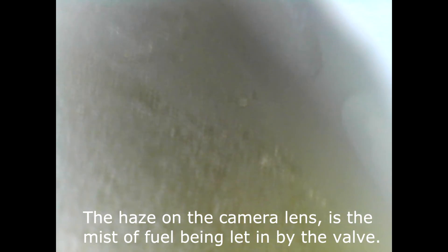It's worth pointing out this speed is actually just the speed the engine is turned over to get it to start — when the engine is running this process would happen at a much quicker speed. This is a petrol engine, but a diesel engine works in very much the same way, only rather than using a spark plug to ignite the air-fuel mixture, we use a glow plug instead, which glows white hot to create much higher temperatures. That combined with more compression of the air-fuel mixture is what causes diesel to burn.